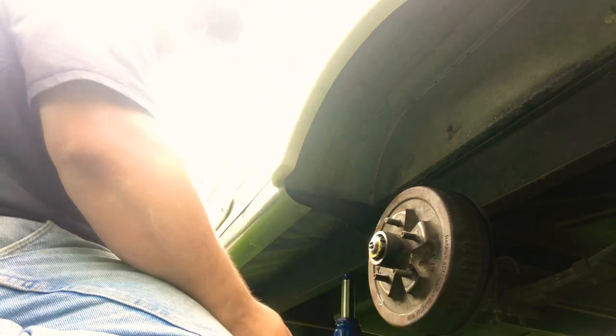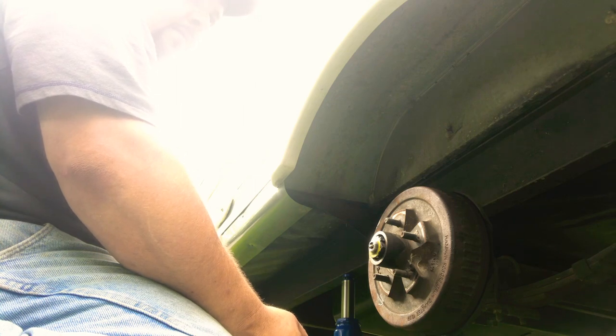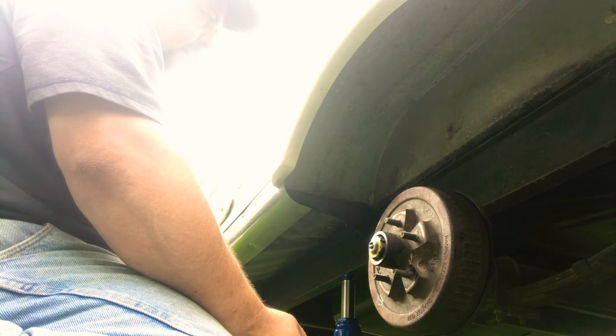I think that'll take care of the problem. We'll put the tires on and I'll monitor it as we use the trailer — the miles I put on it — to see what it looks like. If it's not a bearing issue then I have an axle issue, but looking across the trailer from side to side the axle still has a crown in it. It kind of frowns, which means it hasn't lost its camber yet, so I don't believe we have a camber issue — but that doesn't mean I don't have a bent spindle.